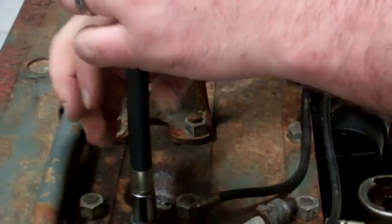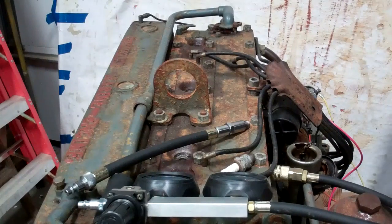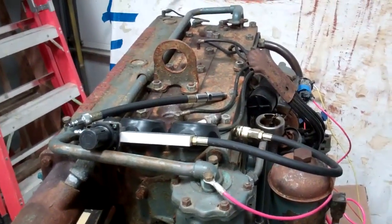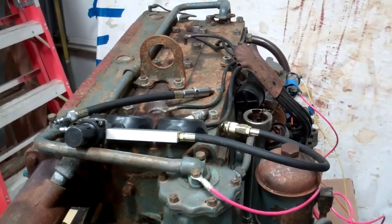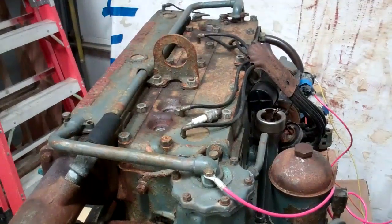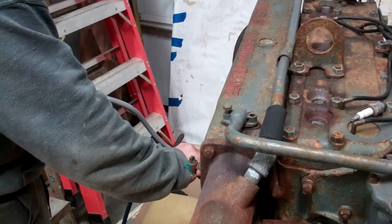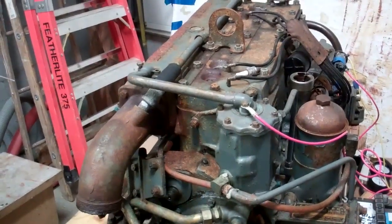Based on those two tests, this engine at the very least must be torn down. Of course, remember this is the engine that went through the crash with the rocks — we don't know what if anything is wrong with it internally. Our next step will be to turn the engine over and Anthony is going to put the stethoscope on and listen down low on the block to see if he hears any odd sounds. He doesn't hear anything out of the ordinary.